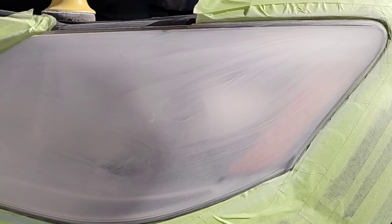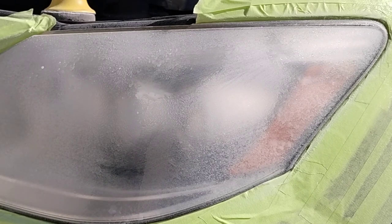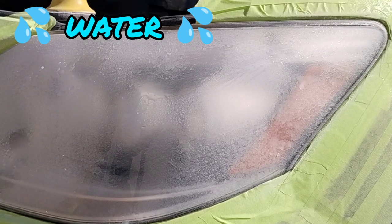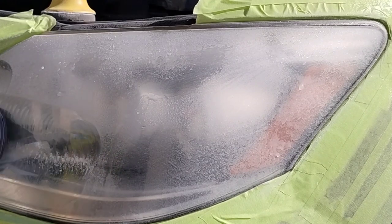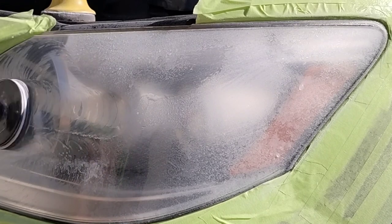I used to not use this step until I ran into certain issues — seeing scratches or striations in certain areas and not being satisfied with my overall smoothness. This is a step that adds a ton of clarity, smoothness, and visible luster back into the light. After that, you're going to go with water and the 3000 Trizac pad. This is a magic pad, and there's only one place I know of that makes it — that's 3M.